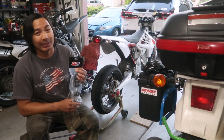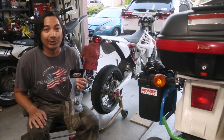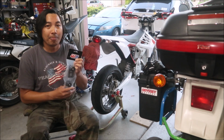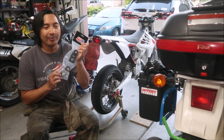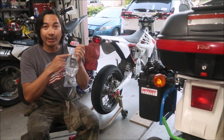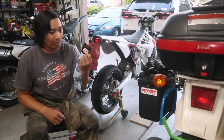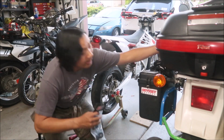The reason to have them is if your bike goes down, it slides and doesn't damage the track, so no metal contact. These have Delrin sliders on them. Basically, they take the place of your axle adjuster blocks, and there's a little puck on it, and the puck is what lets the bike slide if it goes down. So this is the specific model that I got.